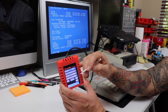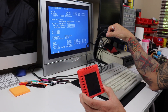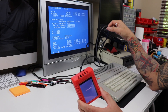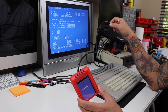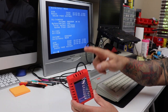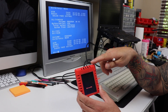Four drives emulating. With the S-Drive Max on this 130XE I have no external power — just connected directly to the Atari. I can go on the road with this, go to shows, to friends' houses for program trading. All I have to take is this S-Drive Max — no external hard drive or floppy drive needed. Coupled with my Sparta DOS cartridge, I've got everything I need to run the Atari computer efficiently and effectively without a bunch of cables. A great solution.